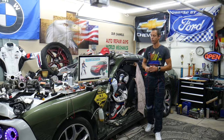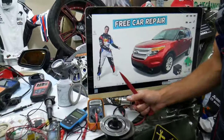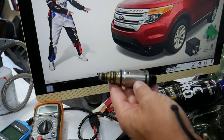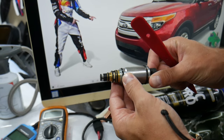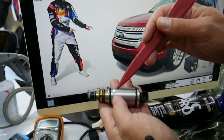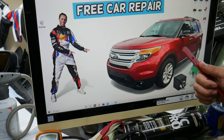So guys, where can you expect to find the fuse and relay for the AC compressor control valve solenoid? This is the solenoid. Many people will replace their AC compressor and pay hundreds of dollars just because of that valve, when that valve is actually replaceable. If you want to see how to test the AC compressor solenoid valve, we'll have videos on our channels that will teach you how to do that.